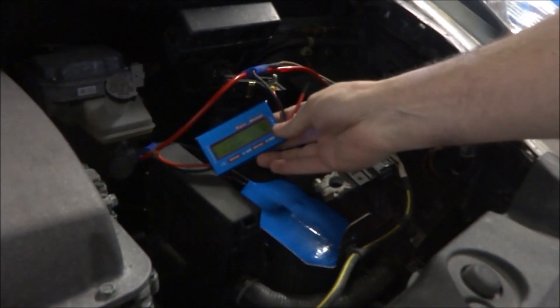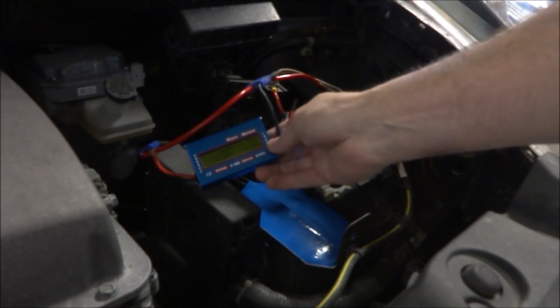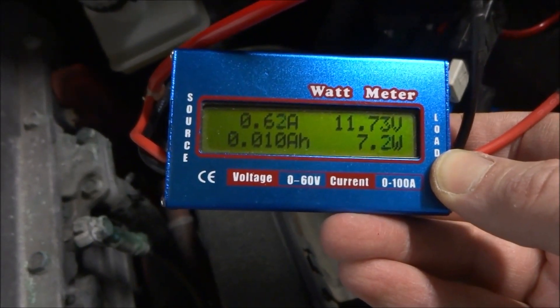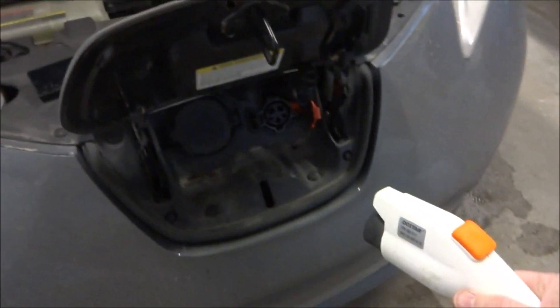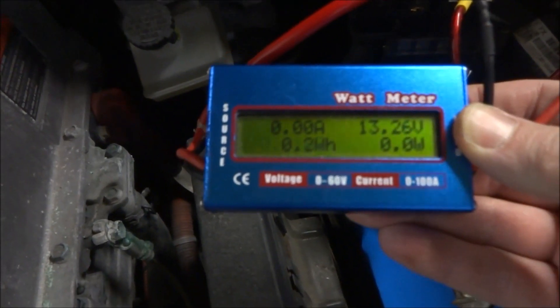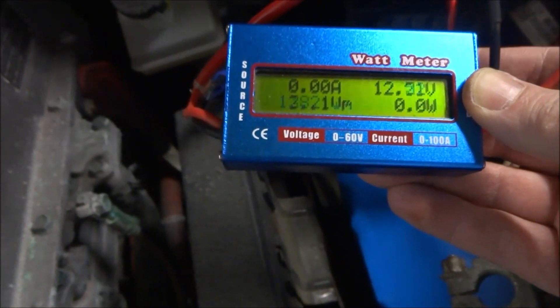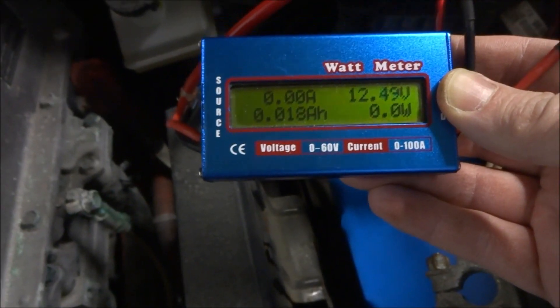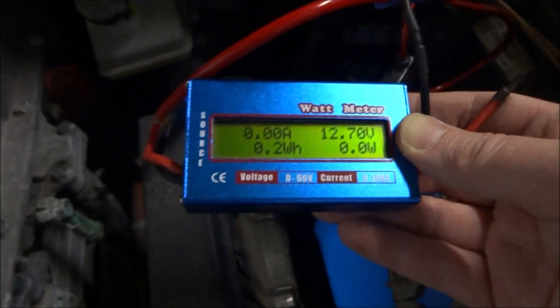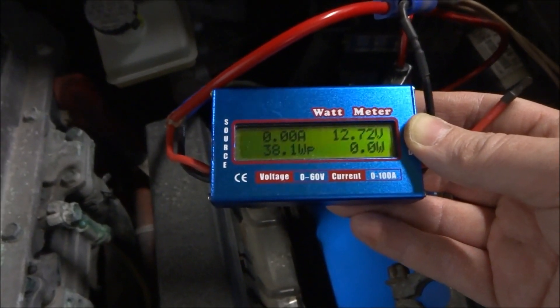You heard the car clicking. It's currently consuming about 13 watts, now down to 7 watts. I'm going to plug the car in — you can hear the car is now charging, the lights are flashing, and we have 13 volts. It's not registering any current because the meter is designed to count current going from the battery to a load, and the car is now charging this lithium battery. Everything seems to be working fine. We'll let that go for a while and see what happens to the voltage.